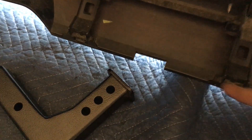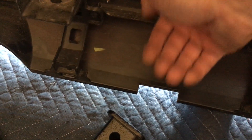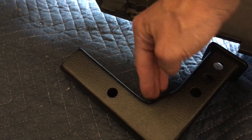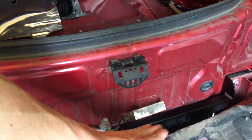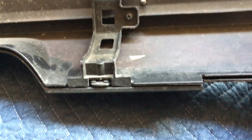Right here I cut a notch out about half an inch, but it's still being pushed up because the lip is hitting right here. So I need to push that down. If you don't have the arrow kit, you might be able to get away with the hitch being slightly higher, though probably not by much.